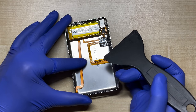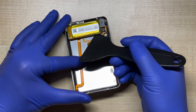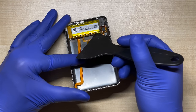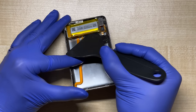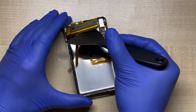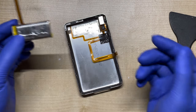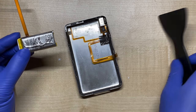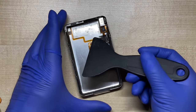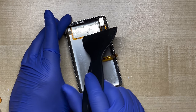Because we're going to be using a completely new battery, we need to remove this one. Something to be aware of is that these batteries are normally held down by very strong adhesive. Normally I would use a spudger just to pry it from the bottom, and because the glue is old, it's come off right away. But if you're finding some difficulty, you can just use some alcohol, and that should soften the glue. Also, when prying, just be very careful and make sure you pry on the right side, and don't pry on the left, because you can easily tear the cables there.